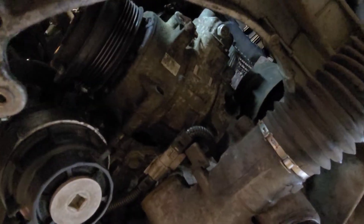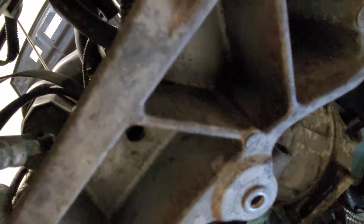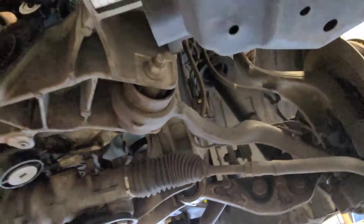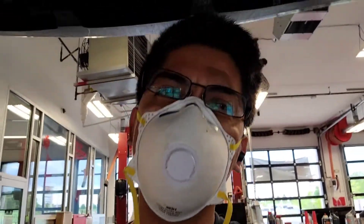I'm back again — like I said, I'll keep updating this. Here it is: there's the compressor, I got all the studs out. Took me a while because you've got to put your arm in there and put the ratchet, but like I said, it can be done. I should be able to pull it from the other side, all the way up there — and she's out. I didn't have to remove the subframe, and that's what you call easy. Thank you for watching and I hope you enjoyed this video.